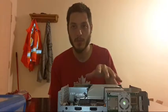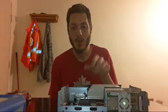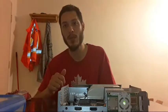When I reset the console — which was really weird because I had nothing plugged in at the time — before, when it two-red-ringed, it reset itself. When I had everything apart and put together and it sat for that period of time, it must have properly reset. Because the RAM chips had pennies wrapped in electrical tape not touching the right spots, that must have caused a short in a few areas. They were just touching the VRAM but crooked on the chips, and that can definitely cause a 0031. That's probably what happened. She's fixed.